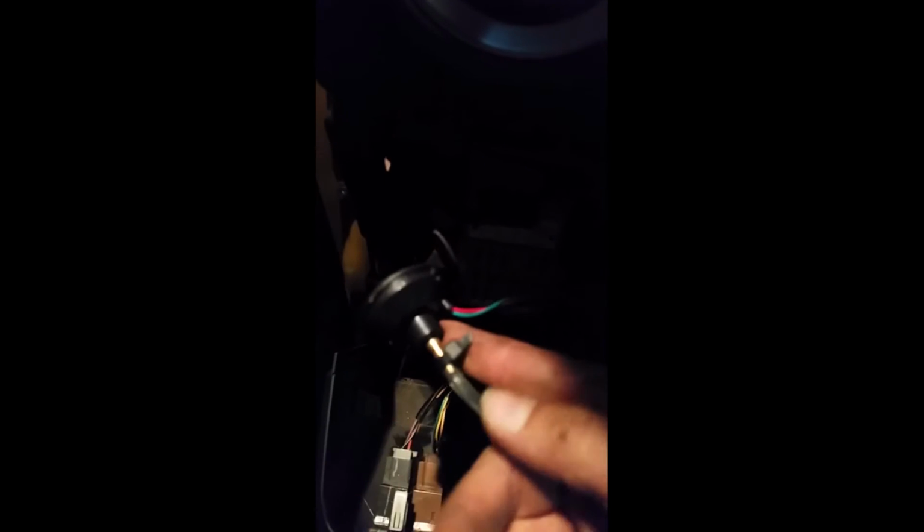Just so you guys see, in my previous video I talked about a shitty solenoid that comes with this boost gauge right here, and it's this. I mean, look how cheap that thing looks. Really focus on that. You can see right there it's split open. And it's been like that since I bought this thing. So I'm going to go ahead and say this is probably leaking a little bit of boost, and I'm going to pull this out.